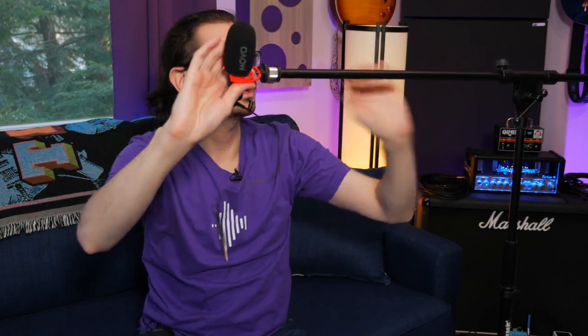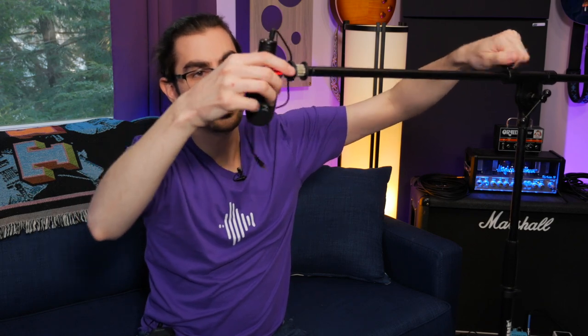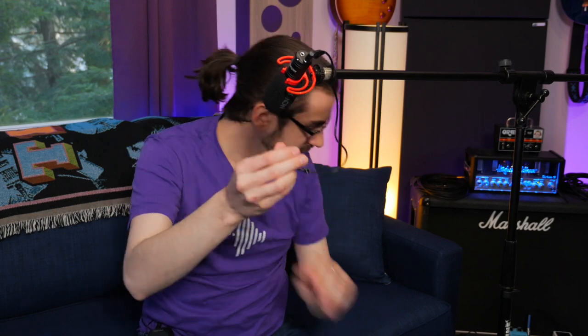So let's say you're using this TRRS-to-TRS cable. What do you need for the extension? You need a female TRS, because this cable ends in TRS. Now you have TRRS going into TRS, a female TRS extension into TRS—which you can plug into a portable audio recorder or a camera.